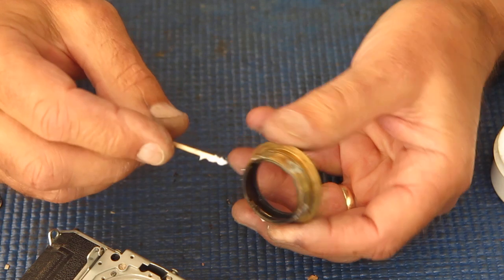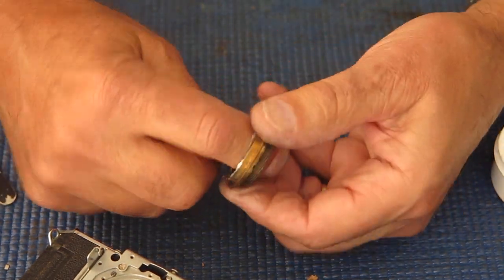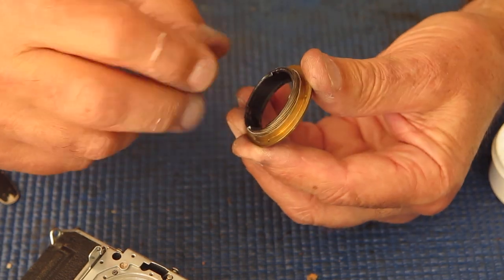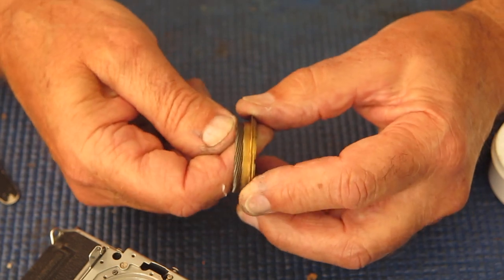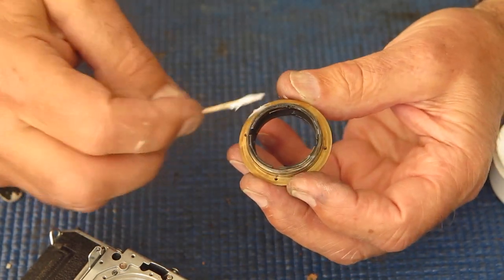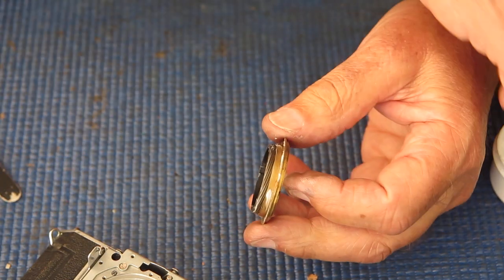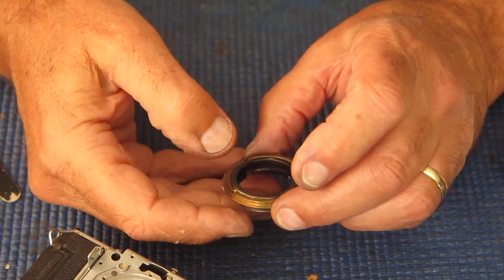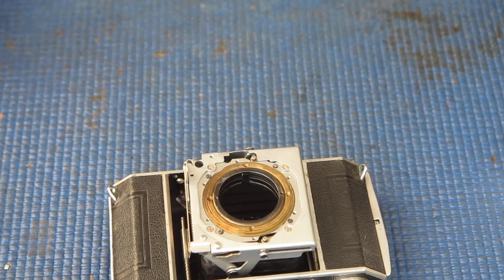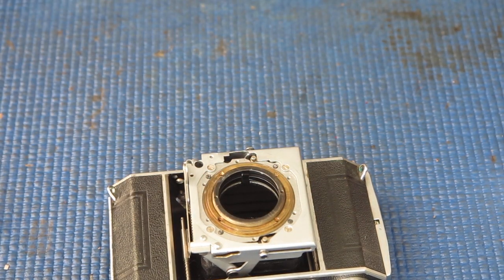One of the odd things about this camera, I think it's the first time I've seen that film advance lever with the lock components missing from it entirely. It's not uncommon to find cameras with that lock component which locks the film advance when the frame counter reaches number 1. It's not uncommon to find that little lever is broken because some ham-fisted individual has not known that you needed to move the frame counter to unlock it, and has just simply stuck their big fat thumb behind the lever and twisted as hard as they can and snapped the lever. But it's probably the first time I've struck a camera where the part's been completely removed, which would of course disable that mechanism entirely.